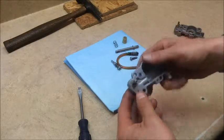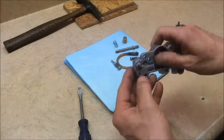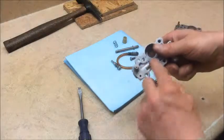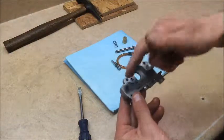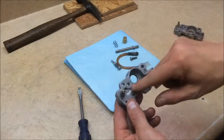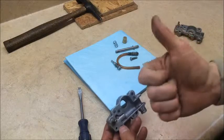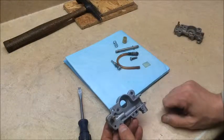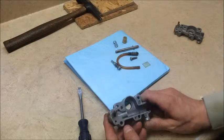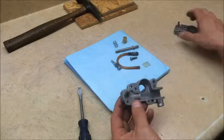A lot of these get clogged up. When they cast these and they drill them for the bypasses, there's no way to get in there and clean it — it's 90 degrees in there and that will get impacted. If that gets impacted, you're going to put a lot of pressure on that oil tank, pressure from the oil tank going to the gas tank. That's the way those case doors, those little door flappers on the case, the little metal pieces, blow out.